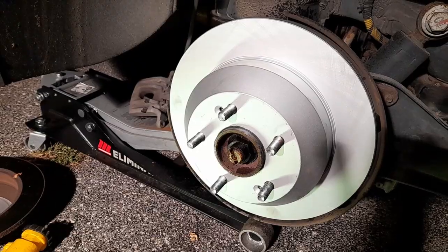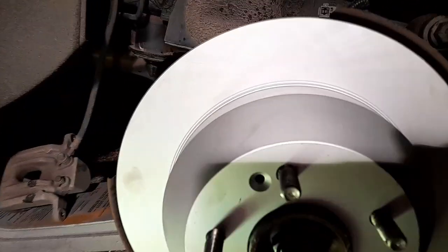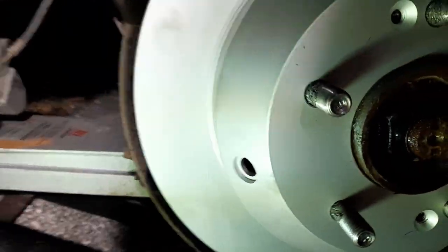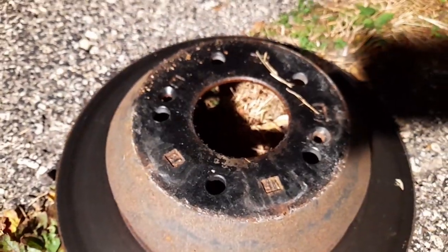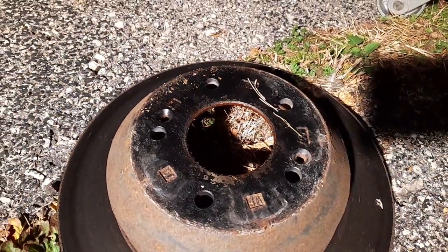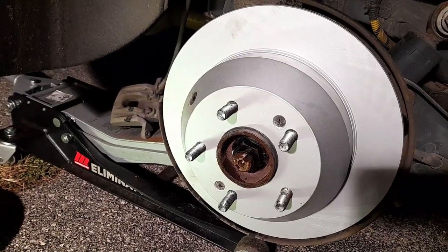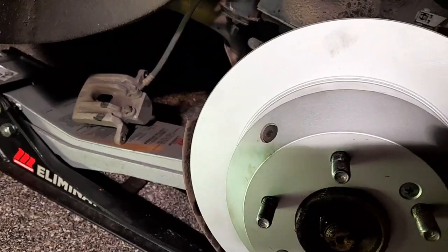The adjuster goes bigger and bigger automatically. Just use a screwdriver and put it down. It looks good — put that screw in at the bottom. Don't forget to transfer that rubber thing from the old rotor. This one doesn't have the rubber — wait, yes it does, right here. The screws are in and the rubber thing is in too.